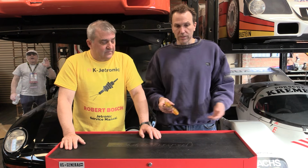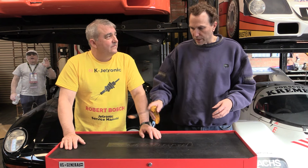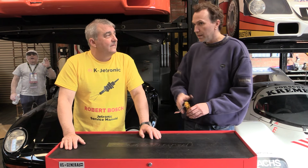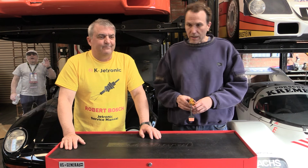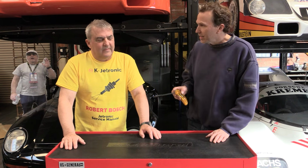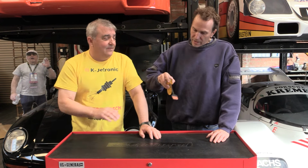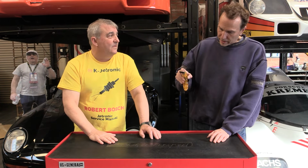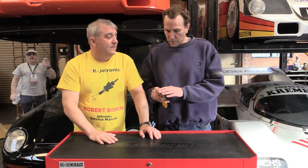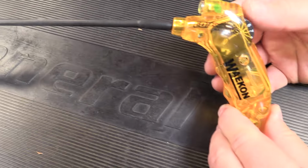So you got 8 coils, one's missing. I don't know which one. Look, just go boink, boink, boink. Oh, that one's weak. Actually, they never just really fail. They're intermittent, and this will tell you. Even more so when you compare them to the others. If there's a coil that is making a different noise on this particular tool than the other ones, that'll tell you it's bad. You should probably replace that one.